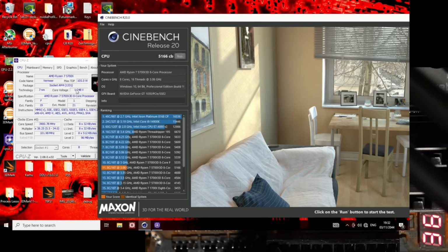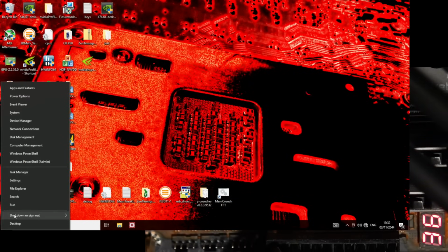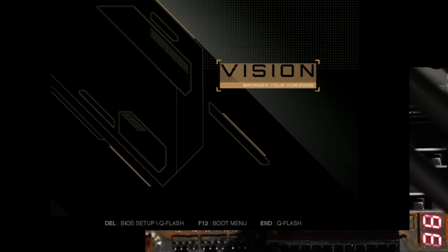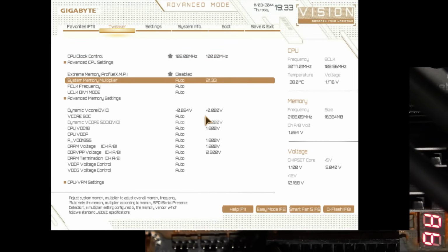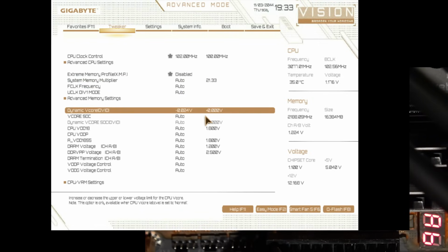So yeah, it's just slower, and I imagine if we keep lowering the core voltage, it's just gonna keep getting slower, isn't it? So that's a 25 millivolt undervolt, and we just lost like 100 points in Cinebench. The stock voltage is high enough to run at 4.2 gigahertz specifically for Cinebench. Though funnily enough, it's not like it crashed in Linpack. It was just thermal throttling.